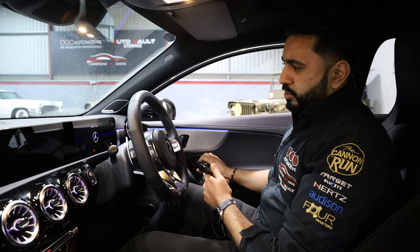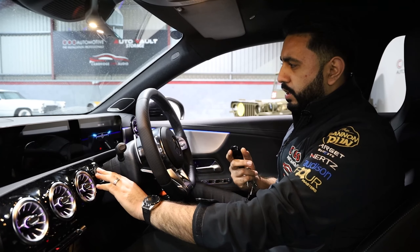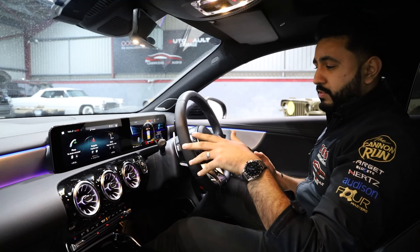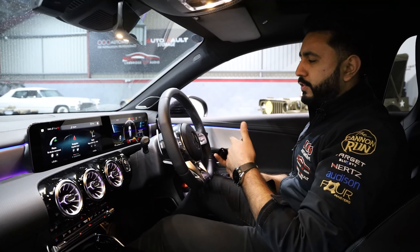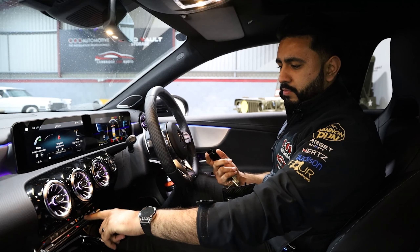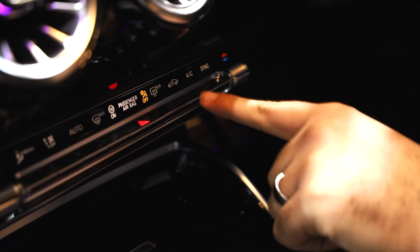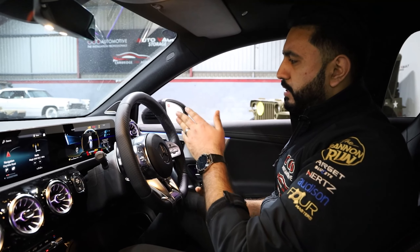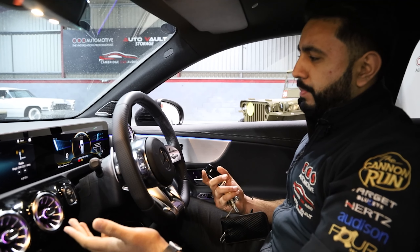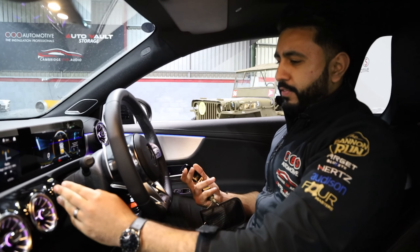So what we're going to do is actually now show you exactly how to start the vehicle itself. What happens is we turn our ignition on, which is here and live. And then we're going to press a unique code that we've tailor-made for this demonstration. Obviously this is going to be changed before it goes back to the customer. So what we're going to do is press the recirculation button here four times — one, two, three, four. And what happens is on my dashboard I get two flashes of the high beam signal. And what that means is now I can put my foot on the brake, press the start button, and there we've got the lovely engine noise coming from the A35 and the vehicle is ready to drive.